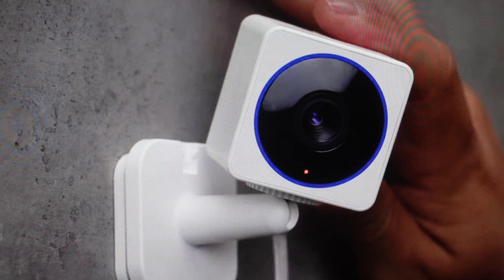Once we do that, we're just going to press the setup button on the bottom of the camera for 10 seconds. While we do that, we're just going to keep an eye on the indicator light right in front of it. Then we wait — the status light on the front of the camera will turn solid red. Once that happens, we can let go and let it finish. Once that solid red turns into flashing red, it means the camera's reset, and now it's in setup mode, ready to be set up like a brand new camera.